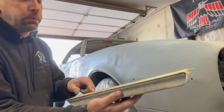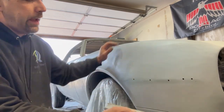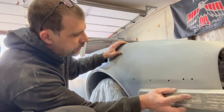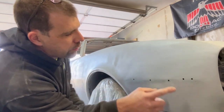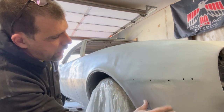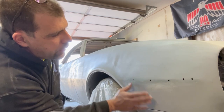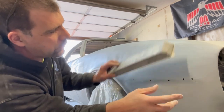I'm going to start here with my longest block, put 80 grit sandpaper on, and just kind of hit this back and forth to see how bad it really is. It might bring to light what I've got to work with. I'm going to work from our imaginary body line, which isn't there yet, at 45 or 30 degree angles back and forth, and get the bottom cut. I'll do it where it should be and do the top and see what it looks like.